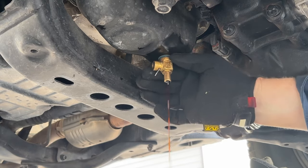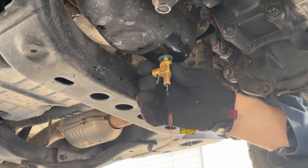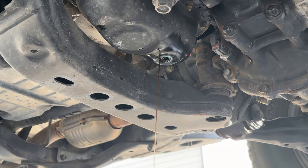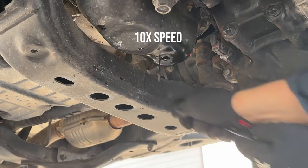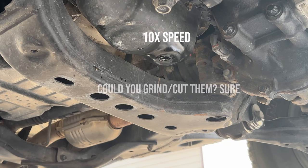Check this out — I've already drained all the oil, let it drip for an hour, but look how much more oil is going to come out. In fact, it's over a cup of leftover dirty oil. The reason is simple: the threads on the drain valve are taller than the threads on the drain pan, so there's a pool created around them.